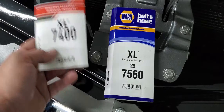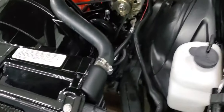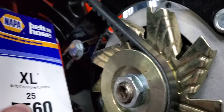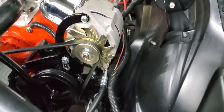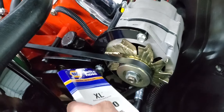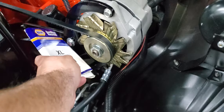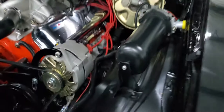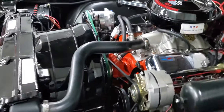These are the belts I used — power steering and alternator. Keep in mind that with this exact setup you're going to have to modify this bracket and probably that one too. I had this one rounded out just to make sure it was going to clear — it was very close. If you let one of these loosen up and something moves just a little bit, you've got trouble. This bracket had to be shortened a little bit — they did a nice job.